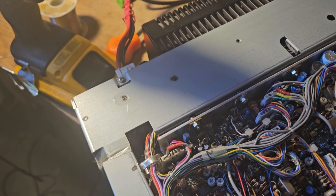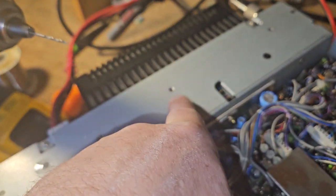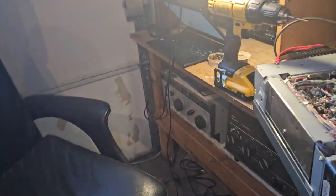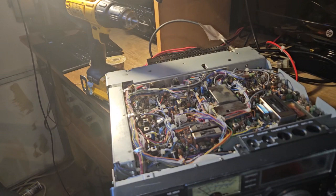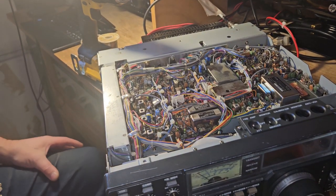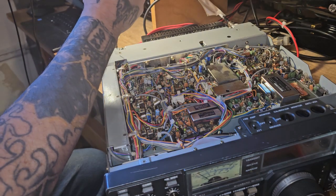I'm doing some more controversial stuff. There's a brass screw that's broken off in here — it should look like that. I've just been slowly drilling it with the smallest bit that I can fit in the end of my drill, carefully wiping as I go. I'm going to come in here with a vacuum.